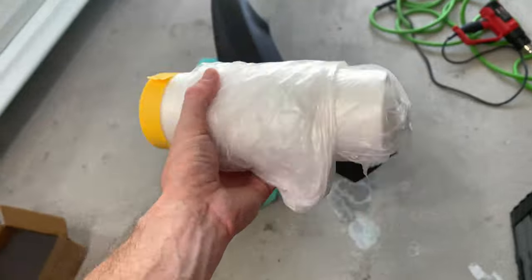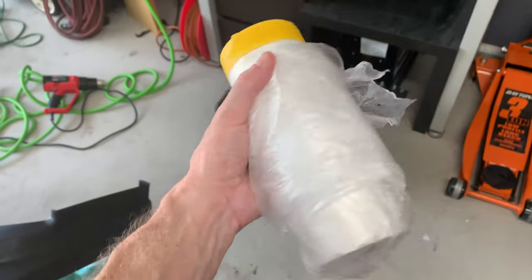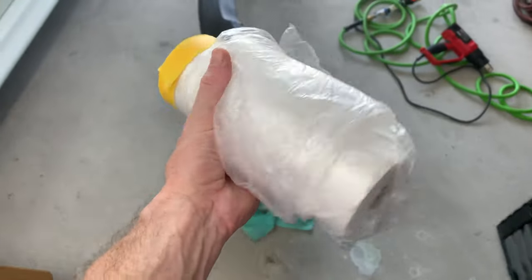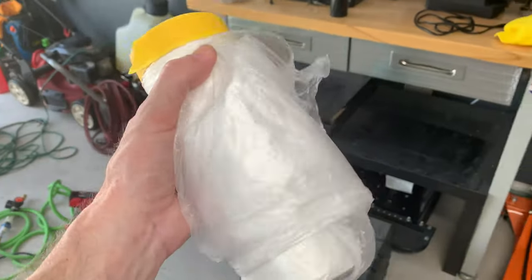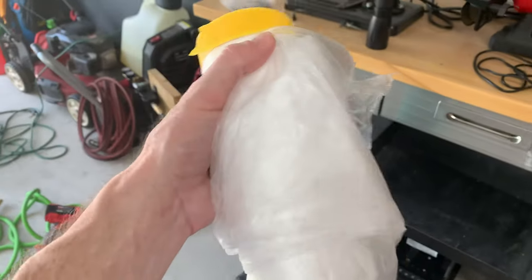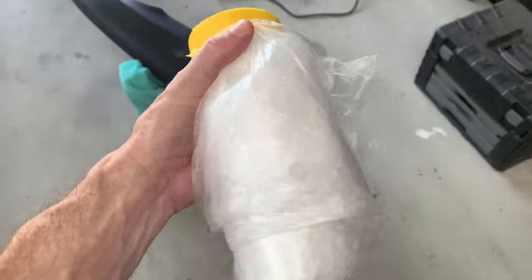This is what I use. It's tape and drape. I think the actual brand is called like Plasma Matte or something like that, but I get it on Amazon. You can get it in different lengths. I did actually have this up already when I painted the rear aprons, but I had it up for a couple of weeks because I had to take different days to paint, and over time as you open and close the garage door, it just eventually tears it up a little too much.